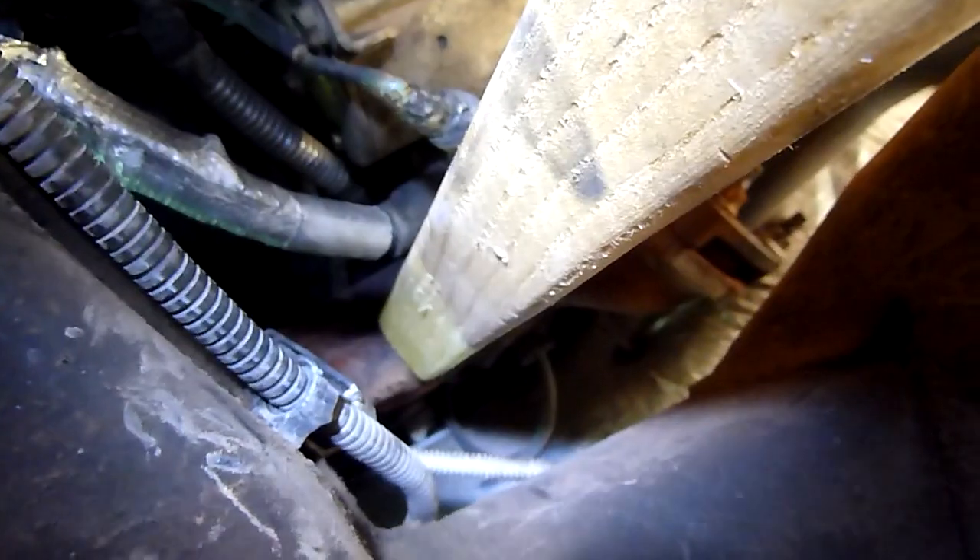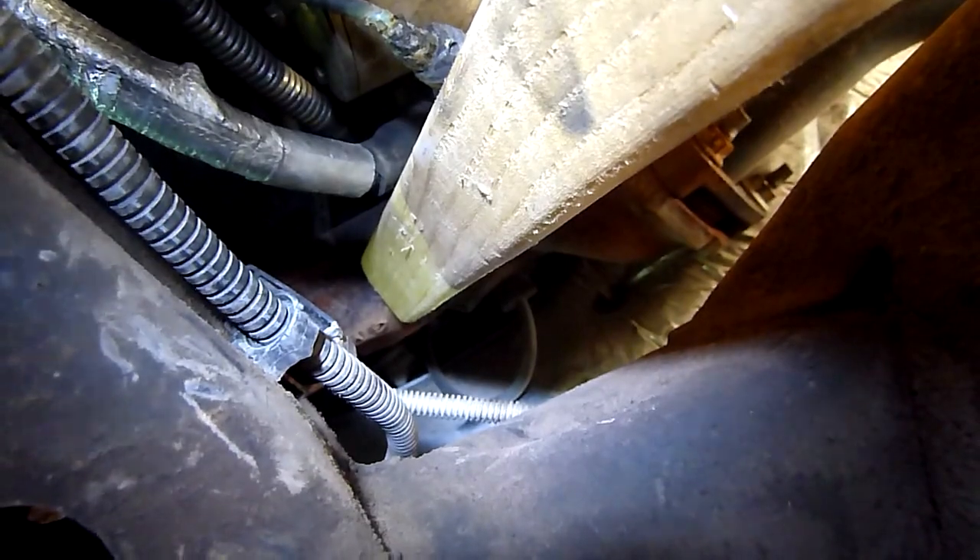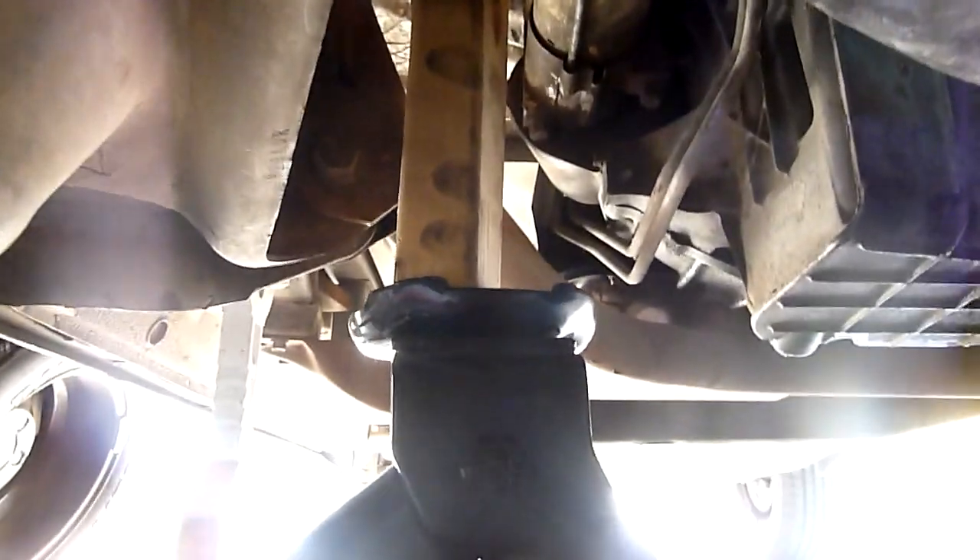The other thing I had to do was rig up a 2x4 onto a jack. As you can see, it's sitting on the manifold which is a red rusty color. I kept the 2x4 straight in profile and jacked it up just enough so that it lifted the mount up and out.